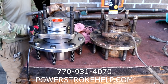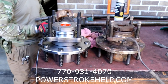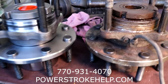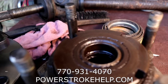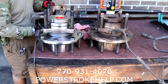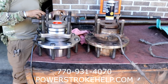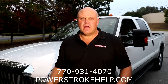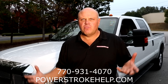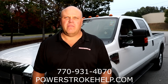And this all got started because the automatic four-wheel drive wouldn't work yesterday when we were taking pictures in the sand. Put the button on, there's no four-wheel drive - I hear the back end hopping and the front end ain't doing nothing. We locked the hubs, but then when we unlocked them this noise started. One thing leads to another, but at least it tore up here where we can do something about it. Guys, pay attention to what you're doing so you don't kill these hubs - they're several hundred dollars a piece plus labor. Make sure the little hoses are on them, make sure you grease them, make sure the seals are right.